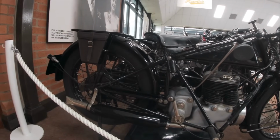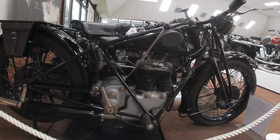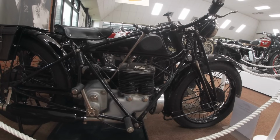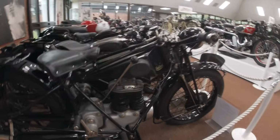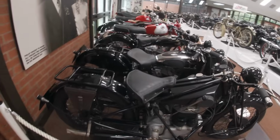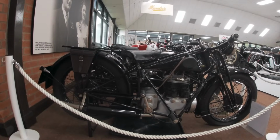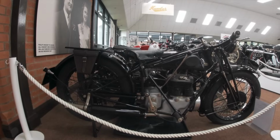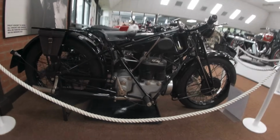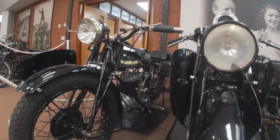Another advanced feature was the use of a pressurised automatic oil lubrication system, rather than the much more common premix used in most two-strokes of the period. However, those twin cylinders and automatic lubrication system did make the bike more expensive, and sales were very slow. Production would continue into 1928, but by early 1929, Francis Barnett decided to wind up production completely. And interestingly, few other companies would make use of the engine, although Monet Goyon in France would make use of the engine for a short period.